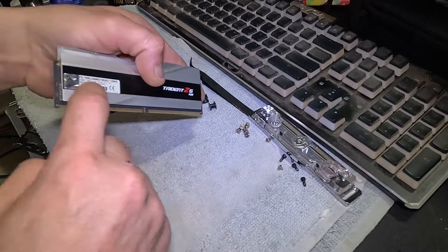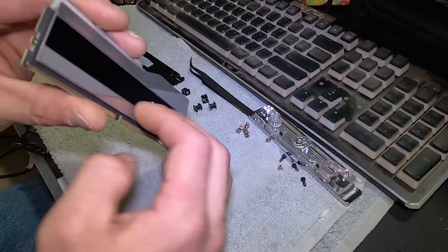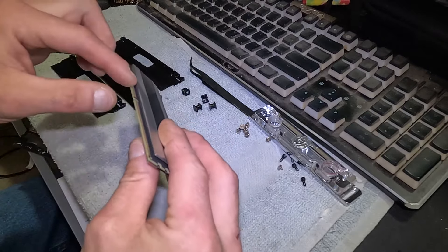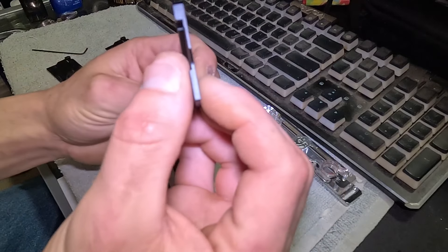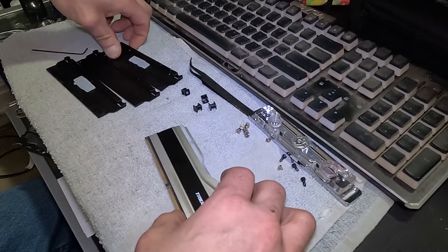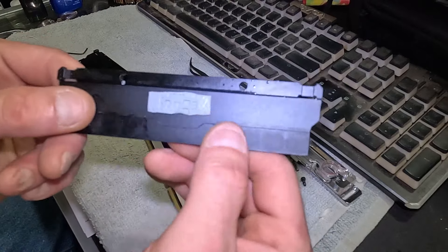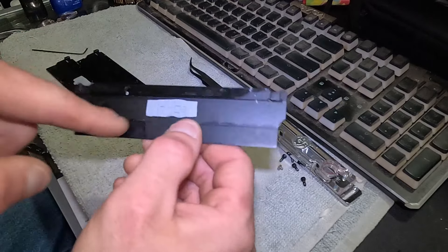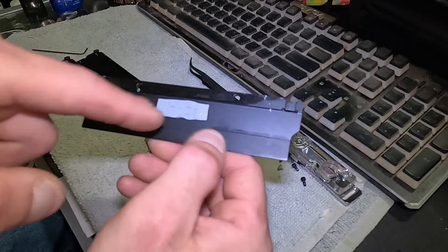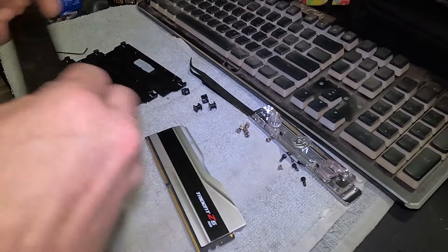Get it warm enough and it'll peel right off — obviously be gentle. The back side has no memory chips, so you heat that up and pop it off too. There's foam tape on that side that I'll need to remove. Looking at the back side of the water block heat sink, it already has the indentation. One heads-up: when you buy these water block kits they do not come with a thermal pad for the power control module — I applied that myself and I'll include it for the customer.